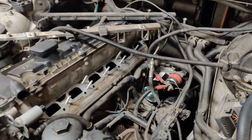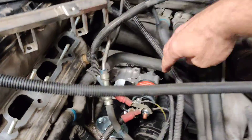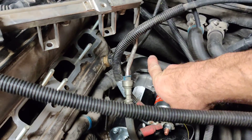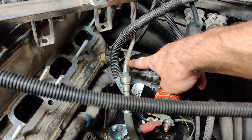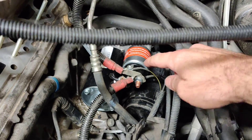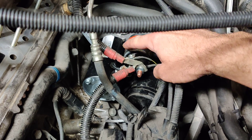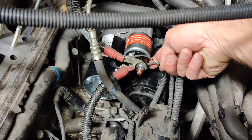You can see I've got a new starter installed in here. The bolts that mount this thing — the heads face the back of the car. There's one over here, there's one here — two mount bolts. And then there are basically three wire posts. I think this one's like an 8mm bolt, that's a 10mm bolt down here, and this is — I don't know — 14 maybe, 12, whatever it is.